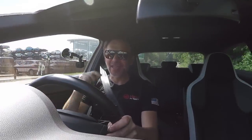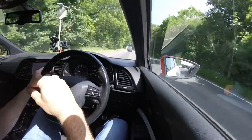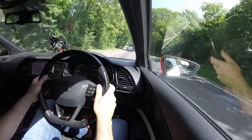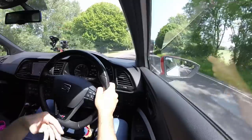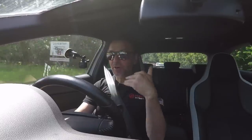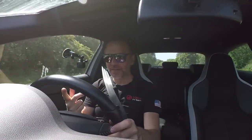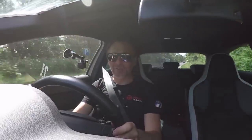The car is now fixed and my test drive will be the drive to Bedford Autodrome — not ideal, but I don't have time to do it any other way. I've stamped on the brake pedal stationary on the driveway and it's rock solid. If you've got a good pedal, it should stay that way even on track. I still need to bed the pads in — Racing Line suggests 10 stops or slowdowns from 60 to 10 mph, then keep driving to cool the brakes down. I should be able to do that on a quieter bit of road.